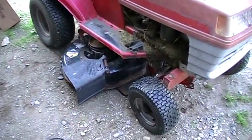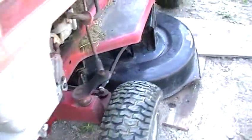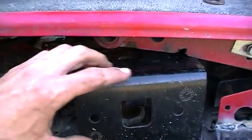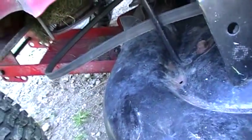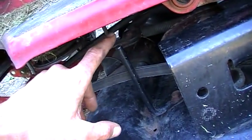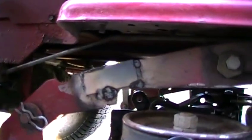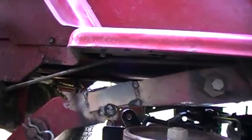The deck's back under there with all the pins set — just checking clearances. We've got the same clearance problem on the other side with this bracket, so I'm going to cut it diagonally because it does act slightly as a belt retainer for this pulley — I'll notch that out. Also, that bolt I thought was going to be a problem is going to be a problem, so I'm cutting it off because it won't work with this mowing deck anyway since the clutch setup is totally different. I've been cutting, welding, trimming, and modifying — I had to reinforce the little arm that holds the mower deck and trimmed this whole piece out to clear the pulley here, then reinforced it so it wasn't weakened too badly.